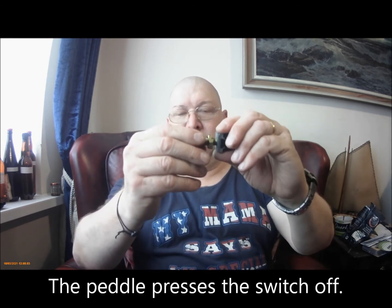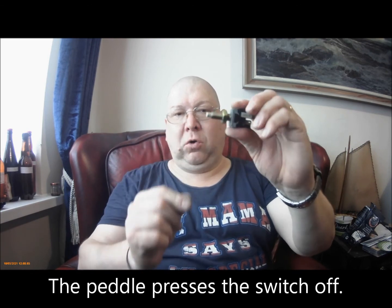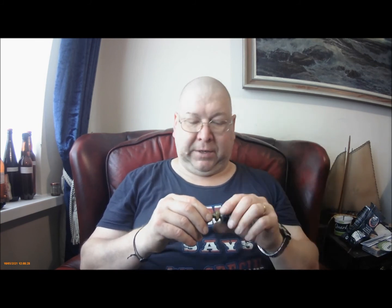What you also need to do is ensure that the lights only just come on before your brakes are applied. So there's a bit of slack. There's about ½ inch of slack in the brake pedal, which as soon as you take that slack up, your brake lights should come on. Your brake lights should come on before you actually start braking. Because if they don't, if you just gently brake in, your brake lights might not come on.